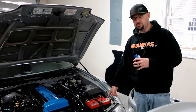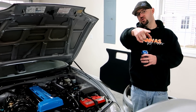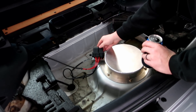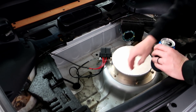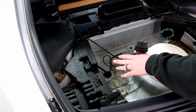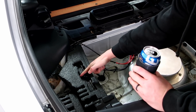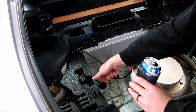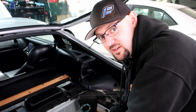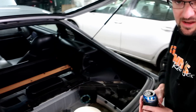So what we've got to do today is: one, get this battery out; number two, figure out where we're going to mount it in the trunk. If you come to the back, we have a custom fuel tank cover, relays for my fuel pump, and then there's this empty space off to the left — that's where I plan on mounting the battery. I'll either cut up or section off the piece of foam here, cut it in this area so I can actually ground out some metal and use a rivet nut there for my ground. You want to be very close with your ground — if you don't have a proper ground, you're going to have fire issues.